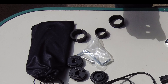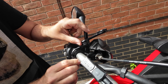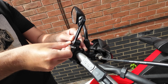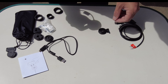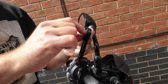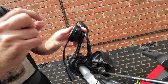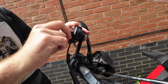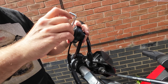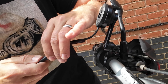Installation is super easy — you do not need to take it to a professional. You can do it at home. It really is just grabbing the right size rubber that goes around your handlebars and grabbing your Moto Mount Pro. There are three screws to do up on this entire job. You tighten it up on the handlebars in the position that you like, then adjust the long stem of the Moto Mount Pro into the position you like. Grab your charging anti-vibration module, that goes into the top of the Moto Mount Pro — one screw to take out and then put the long screw in. Tighten it up and that is that simple. You can wire it straight into the battery or into the ignition, but in my case I've already got a USB on the bike so it was just plug it in and it is done.